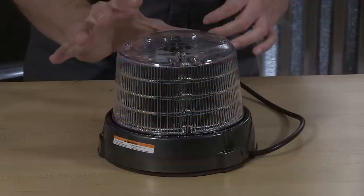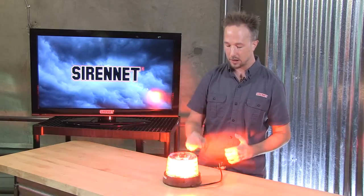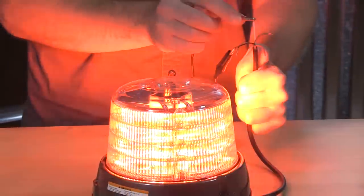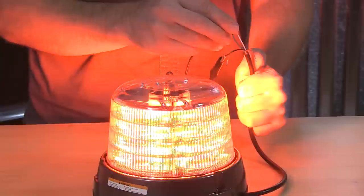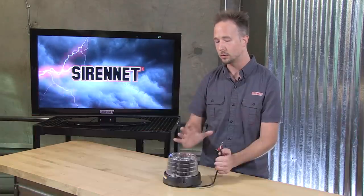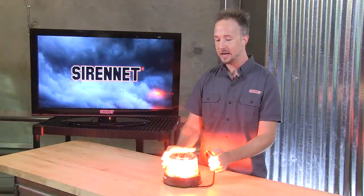Light up your system, and here you have the example of the amazing 360-degree output of the Pro LED Beacon. The style is further enhanced with 25 user-selectable flash patterns, and that's done with a momentary positive trigger. When activated in one of two user-selectable modes, you can have this work two different ways — two switch formats or a park input. The main ground connection goes to the black, red is applied to the white, and to make that pattern change, green is momentarily applied to red, advancing it one time around. Federal Signal has done some really great pattern programming with this — definitely something for all of you to find. As you can tell with the flash patterns, something slow, something fast, and some nice randomizing modes.